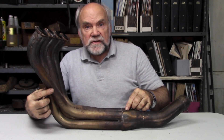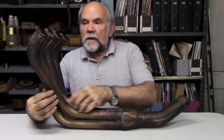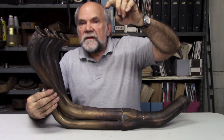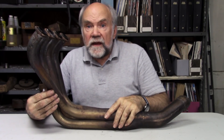That junction is a point of expansion. Wherever there is a point of expansion, a negative wave of pressure is reflected back up the pipe. If the engine is operating at the design RPM for this effect, that low pressure will arrive in the cylinder during what's called overlap. The piston is near top dead center, the intake valve is beginning to open, and the exhaust valve has not yet closed. That period when both intake and exhaust are slightly open is called overlap, for obvious reasons.